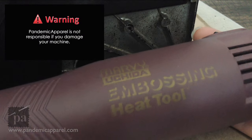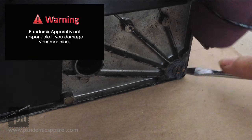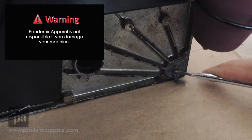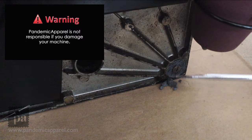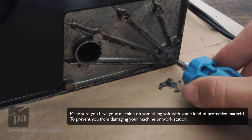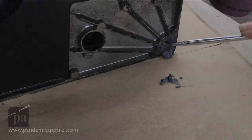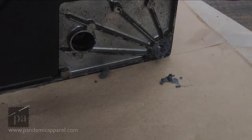I'm using an embossing heat gun. I just heated it up a little tiny bit just to remove the rubber that was in front of the screw, and then I'm going to take off the screw and finish taking off the rubber feet. I don't have the heat gun on there all the time — just enough to get it a little bit soft so I can scrape it out.